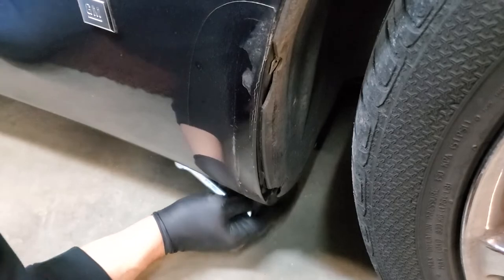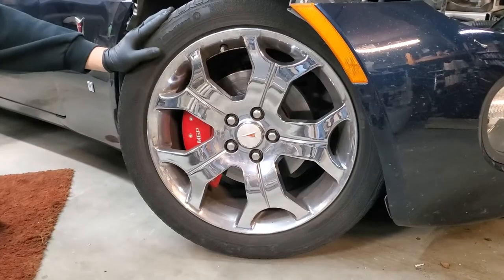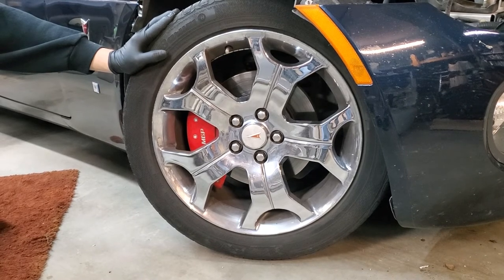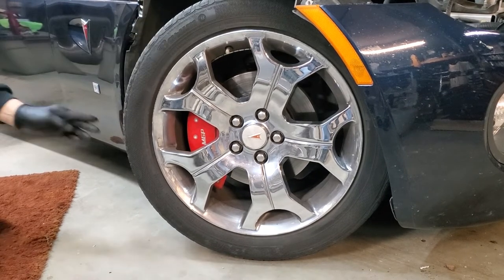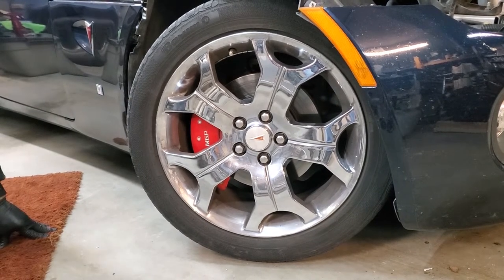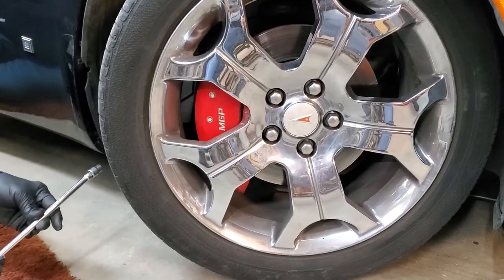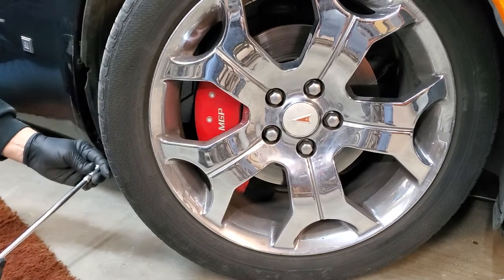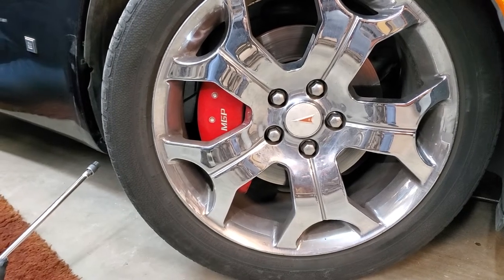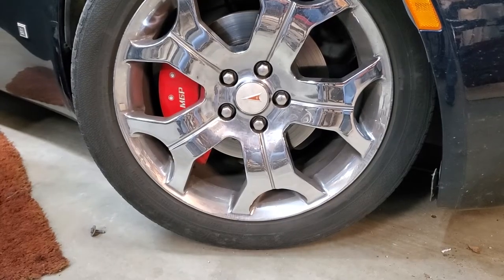Now that we've pulled that seven millimeter, you can see how loose the back portion is. I've rotated the wheel all the way to the driver's side — the reason we're doing this is we need access to our next fastener, which is located up in the wheel well behind the wheel. This gives us the room. The wrench combination here is a Snap-on extension with a swivel on the end and a 10 millimeter socket, because that's a 10 millimeter bolt. One 10 millimeter bolt out.